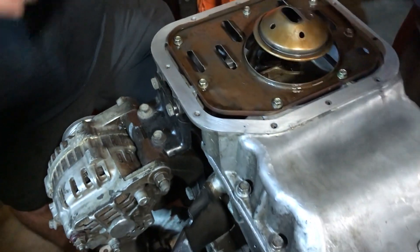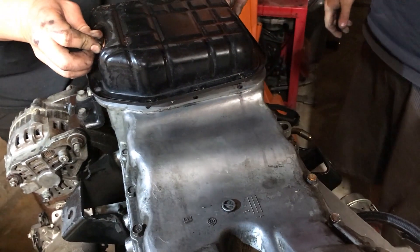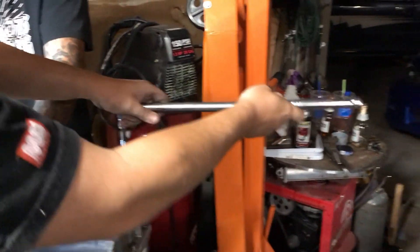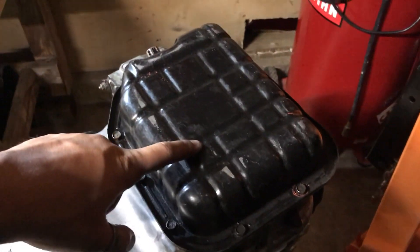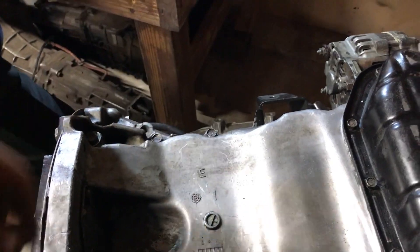Wait - the baffle, I don't even know if that's the right direction. Look at this breaker bar - these are supposed to be 4.7 foot pounds. Guys, the lower oil pan is on, upper one's on and torqued. Waiting on this one to cure a little bit before we snug it down - five foot pounds. That's it for tonight, we're going to let this all cure overnight, let that JB Weld set in really well. Tomorrow we're going in. Thank you guys for watching - go hit the subscribe button, follow along. This SR is going in and I'm doing a burnout in this garage. It's almost one o'clock, we're going to bed - go subscribe, hit the like button, leave a comment. See you later.